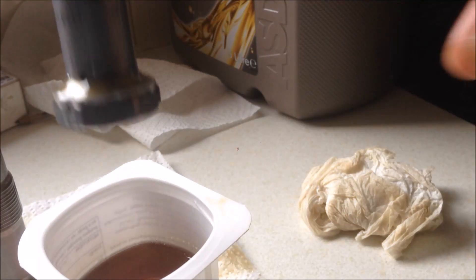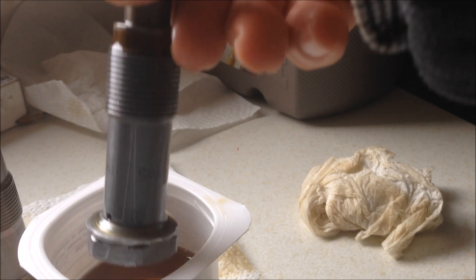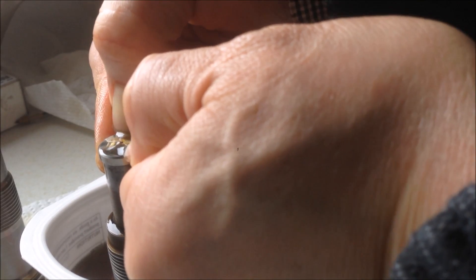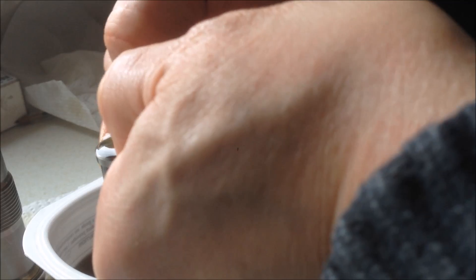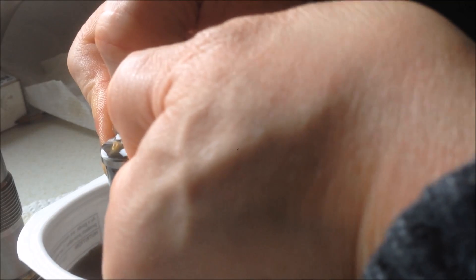And this is the new design. You can see the small hole. There's a small hole at the bottom. I already pressed without blocking the hole — you can see the oil coming from the small hole when I press. Every time I press down, the oil comes out from the small hole. It doesn't matter — whatever I press down, it's solid. Just a little bit of oil comes from the top hole, but the whole tensioner becomes very solid.